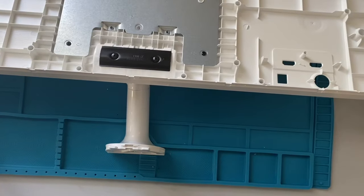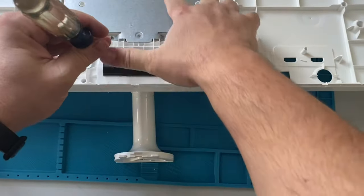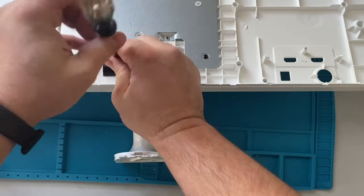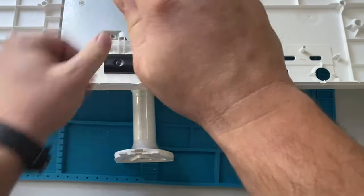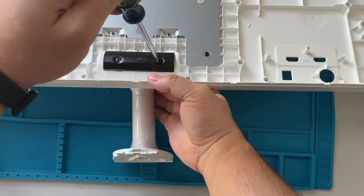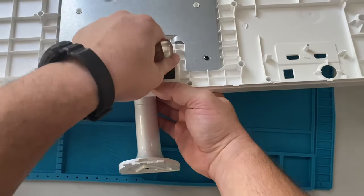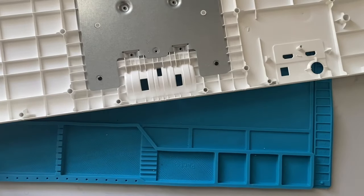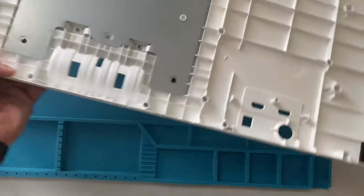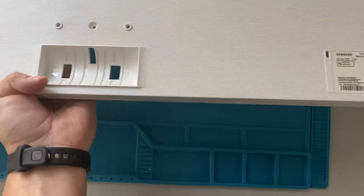Super simple. This is the worst design I've ever seen for something that people — they put the mounting plate in there, they know that you're going to maybe be hanging this on the wall or using it on a monitor arm, and they make you have to disassemble the actual monitor to get to it. It's just a terrible design. Shame on Samsung for doing that. Just take these two Phillips screws out — there's a little metal plate here that retains it. Move that out of the way and there it is. Take this and throw it as far as you can out across the field — but that's the removal process. Now if you look, you're free of the mount being in the way.